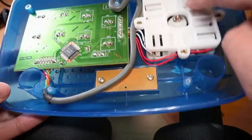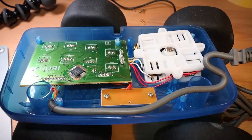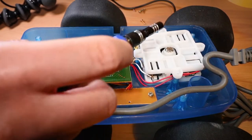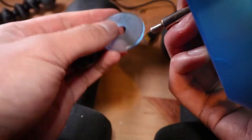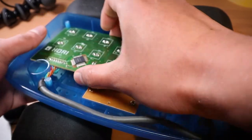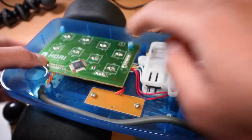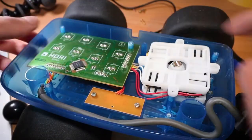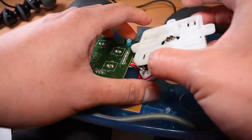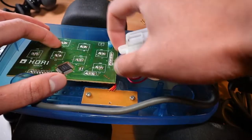I think we'll be brave and remove the joystick. I've unscrewed it from the mounting plate and the ball top is now loose — there's a nice translucent blue dust washer too, which is cool. There are probably clips holding the buttons into the board, and those are soldered into the PCB. Just like the Hori EX stick for the Xbox 360, I might just have to snip these wires, which will be pretty hard to do at the PCB, so I'll snip them at the terminals.